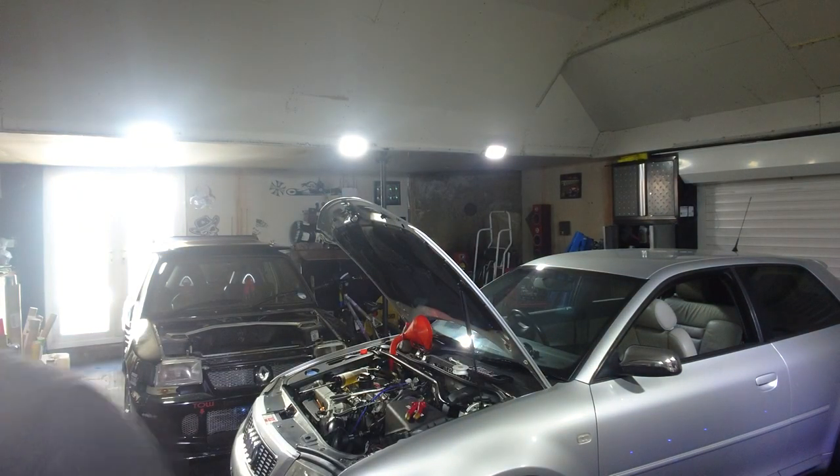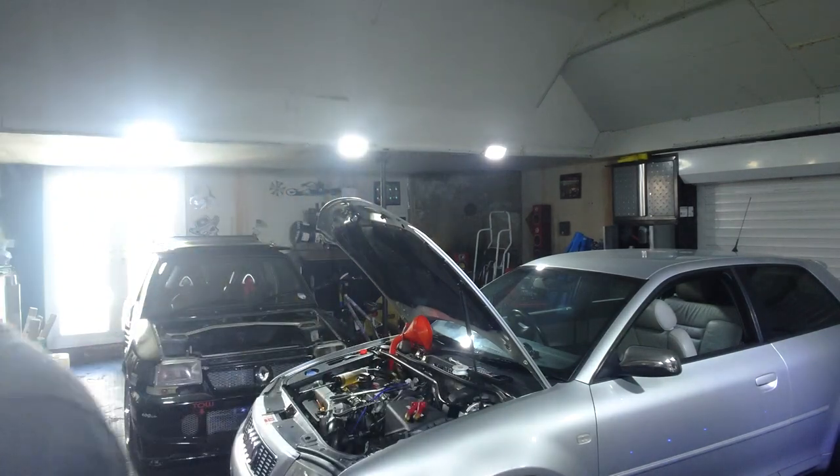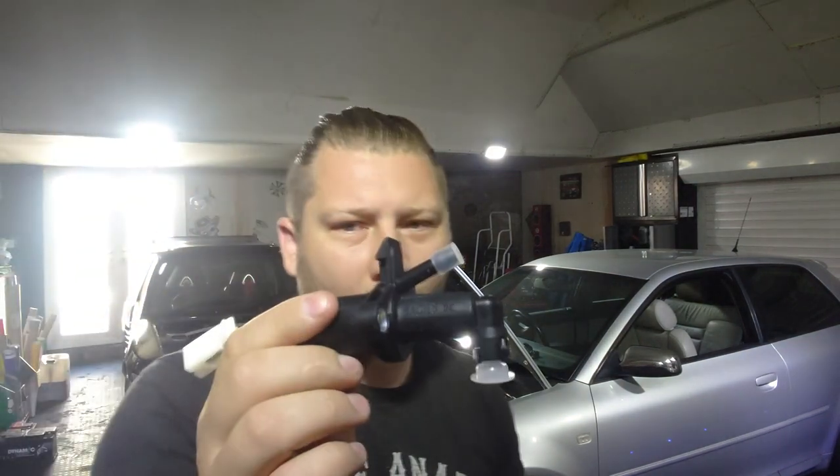Inside there we have two rubbers — this one is completely gone, and that's the other one. We've been pulling it apart to see how bad it is, and they've really swollen to about three times the size, so it's not plunging at all. If you'd ever done the finger test — stuck your finger up, pulled it, and it returned — then the master cylinder would have been fine. But not in this case.